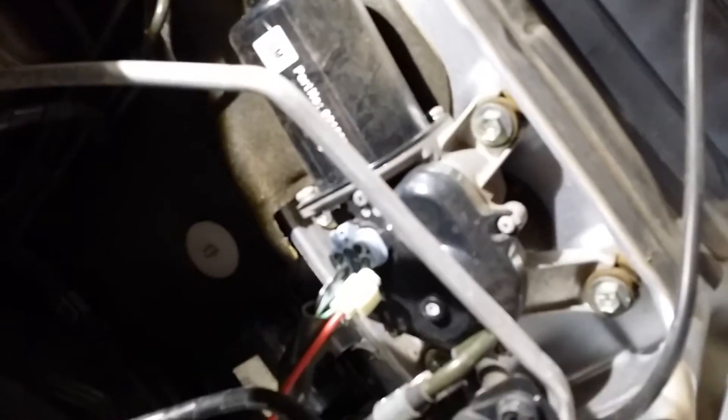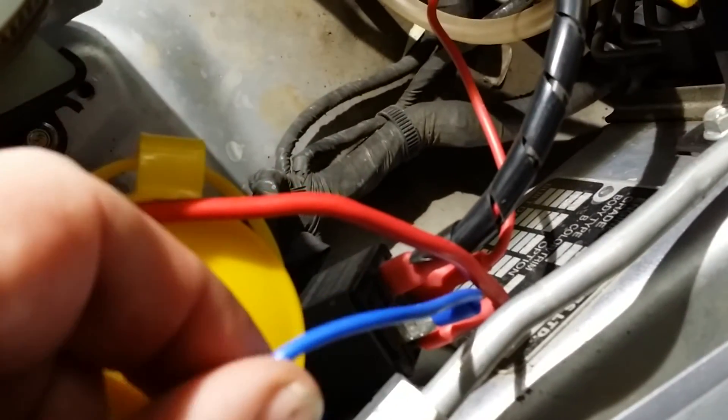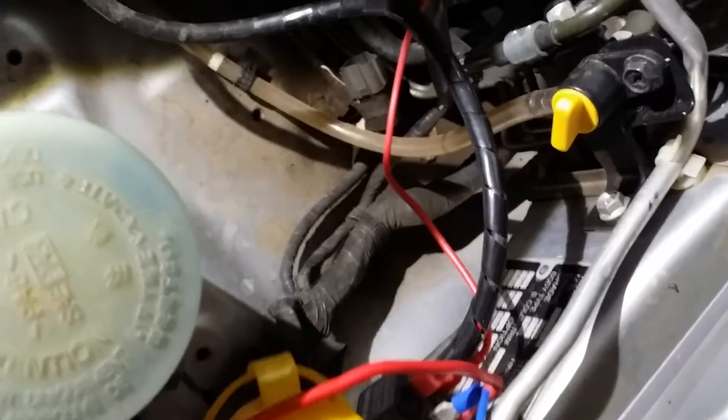My relay is down here — I've got it upside down, but you can see it. You can see the wiper motor there and I've just hooked into the power wire, which comes down to my relay. You can see the blue wire here which goes to the earth, where I've bolted the relay on, which is a good earthing point.